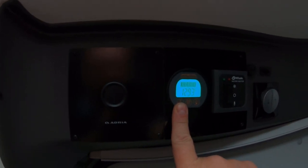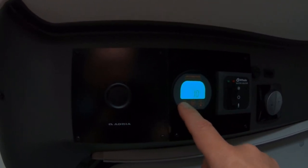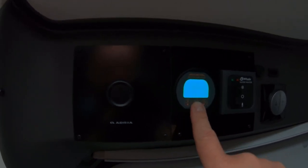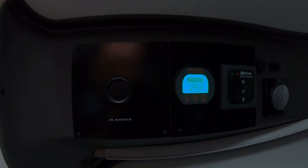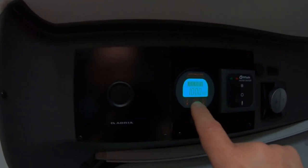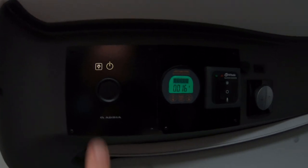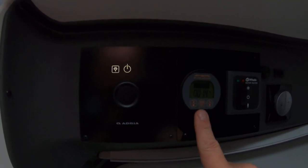You can then push the volt button to set the cutoff voltage - hold the middle button again and you can set the voltage that indicates a dead battery. Reading the manual, most people don't usually set this up so I'm going to leave that at one volt. If the battery is at one volt it's dead anyway. So: the volt button shows voltage, the percentage button shows how much capacity you've got, and the middle button shows how much current you're pulling. The screen goes dark when not charging or discharging - you'll see it light up in a minute when pulling current.